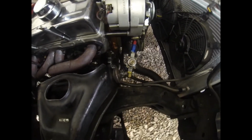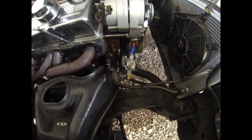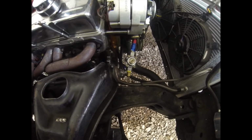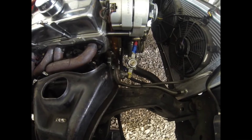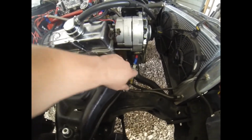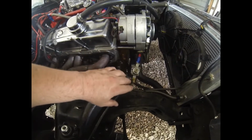And also the regulator wasn't put in correctly, plus when you tried to adjust it you couldn't reach it to adjust it, but it didn't matter anyway because it's put on wrong. But I got that set up right, and it actually works now, and that helped me set the fuel pressure